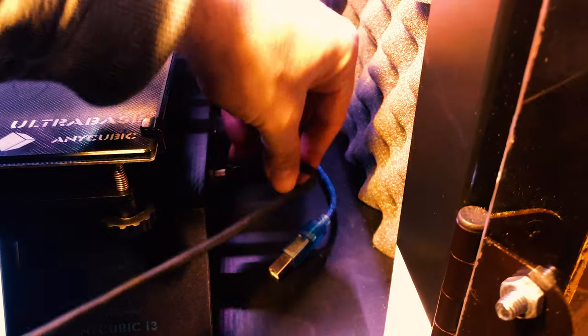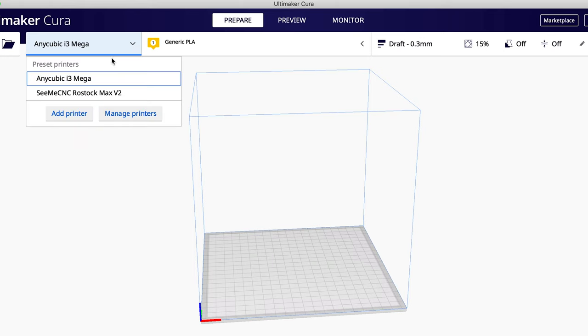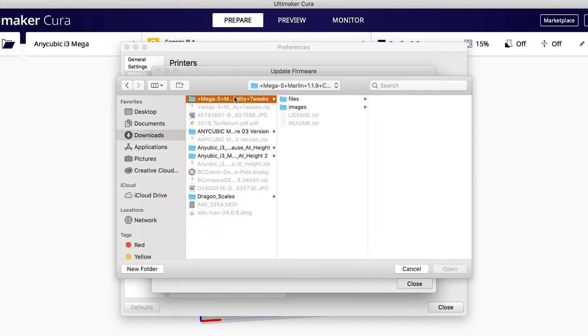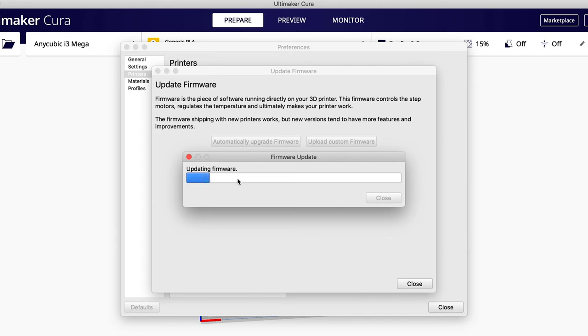Connect your computer to your printer with the USB cable that came with the printer and open up Cura. Click the drop-down at the top left of Cura and click Manage Printers. From here, select the printer that you want to update and select Update Firmware. This will open up another window where you'll need to select Upload Custom Firmware and select the hex that you want to flash. In my case, I swapped out the drivers while still on the original firmware and my motor connectors are flipped, so I'll grab the hex for the reverse connectors. Click Open and it will start flashing the new firmware. When that completes, go ahead and power cycle your printer, and you should be able to tell right away if it worked or not, because Marlin will no longer play the Anycubic startup tune. If you don't hear the startup tune, then your printer now has Marlin firmware installed on it.